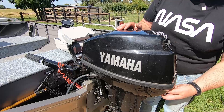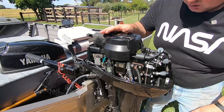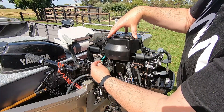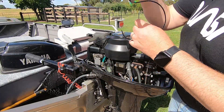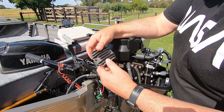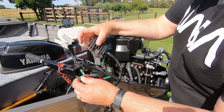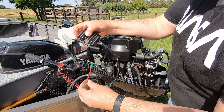I'll just take this apart. I remember seeing some wires in here - there we go. So that's a couple of spare wires and I'm hoping they go to a coil which is up under the flywheel, so that'll generate AC current voltage. I've already purchased a Yamaha rectifier and regulator. Basically what it does is take AC power in through the green wires, convert the AC power into DC and then regulate it at around 13 volts. That comes out on your positive wire in the black.